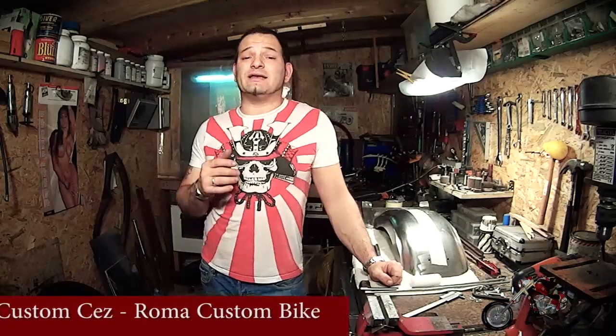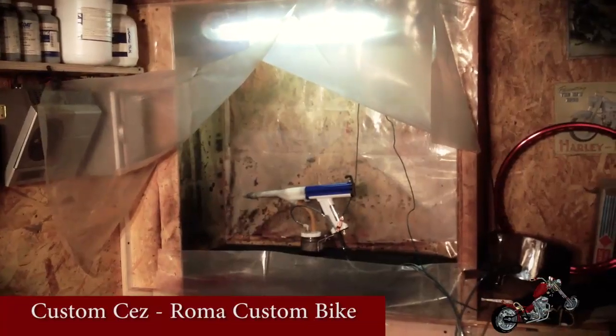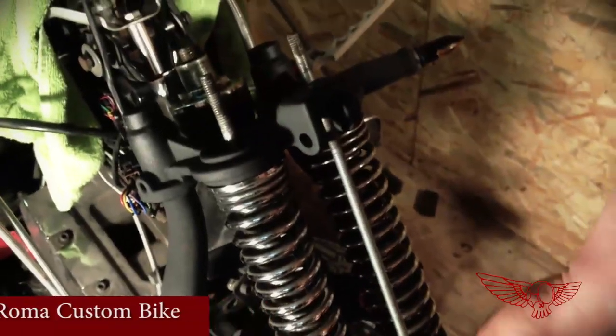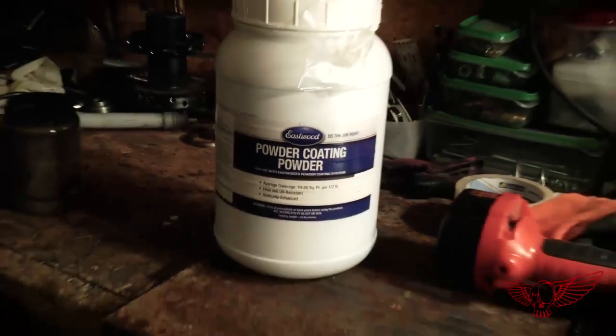In this episode we will prepare the rear fender of my 91 Softail for powder coating in my homemade spray booth and oven. We will use the same paint we used on the Springer Fork — the texturized black from Eastwood, or as I call it, sandpaper black. The roughness of the texture, just like sandpaper, makes it appear even deeper and more opaque than regular black.